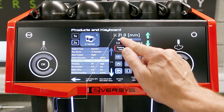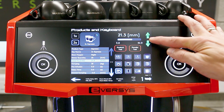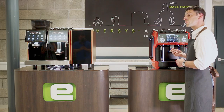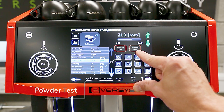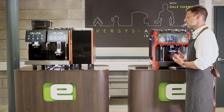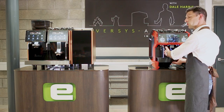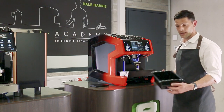Clicking on cake thickness, we have an up arrow to increase the powder quantity and a down arrow to bring it down. We also have Product Test, which brews a full espresso to taste, and Powder Test — a really useful tool that lets us measure dose the same way we would with a traditional grinder. To do that we'll need a set of scales. On this machine we're going to lift the steam arm up and pull the drip tray up as well.